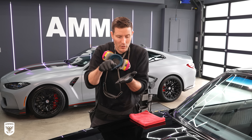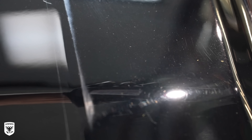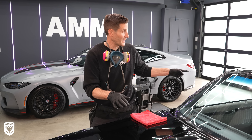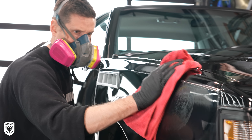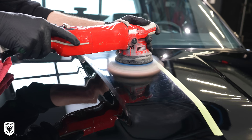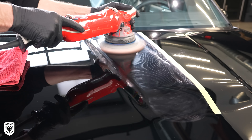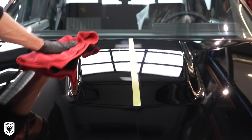On this particular car, because I specialize in these tricky ones, this is super thin — it's like warm, hot butter. As soon as I put my polisher on there, it's really hard to finish out because it is so soft. And at the same time, it's also really thin, so I can't take out a lot of this damage. The technique I'm going to use is a foam pad, because it doesn't remove a lot at once as opposed to a wool pad. I'll be using Exfoliate polish to just barely jewel the surface — a little bit more, a little bit more. We're using a spoon, not a shovel, barely scraping the surface to get these marks out without removing the incredibly thin paint.